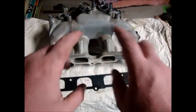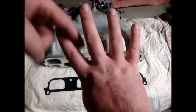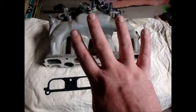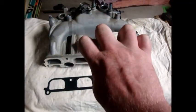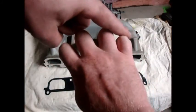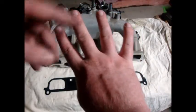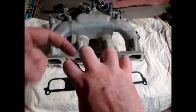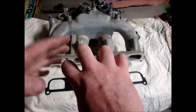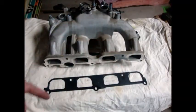What the media blasting does is — say you've got all these little bumps, and we'll use my fingers as an example. Those bumps have grooves. What the media blasting does is it comes along and goes chop — so the grooves are still there, but the bumps aren't so high. That increases laminar airflow because instead of these big grooves constantly disrupting it and creating little torrents, the grooves are made smaller. Similar to the effect of a golf ball, you get these little vortices, and that creates an air cushion for the faster air to travel over the top of the slower air. Is that why they did it? I don't know — maybe they just like media blasting.